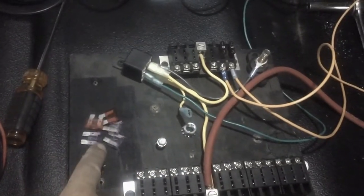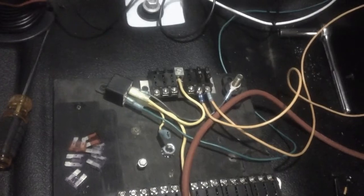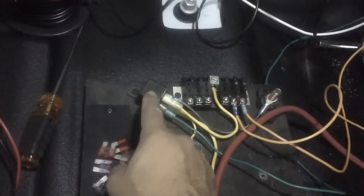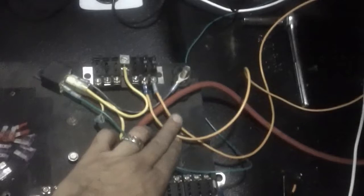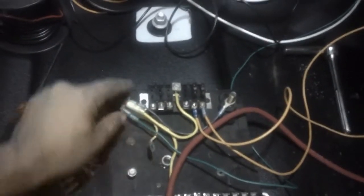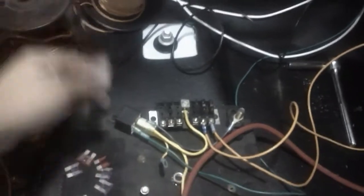I did something different this time — I took out the power tamer because it was taking half an hour before the whole unit turns off, and that's just too long for me. So I'm going straight with ignition switch power feeding directly into my relay here to activate the relay. The relay will apply voltage to this accessory strip for my breakout circuits. I rewired this relay to operate with the ignition switch, which is this green wire here — it's already hooked up in the front fuse panel.